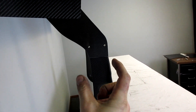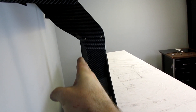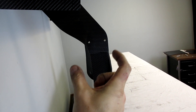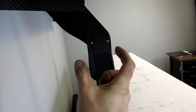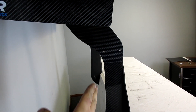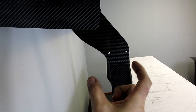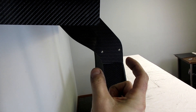One of the updates we did this year was we actually made it a little bit thinner right here. Because where the rear bumper comes up, the C5s have a little more room, but the C6s you ended up having to cut into the rear of your bumper a little bit more than people would have liked. So we ended up making it skinnier this way, so you only have to slot the very top of the bumper.